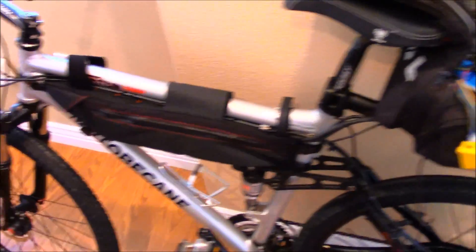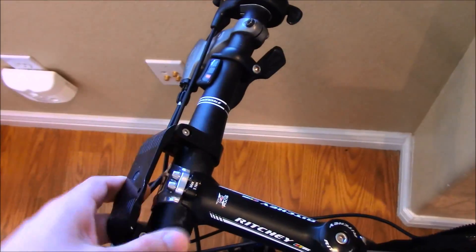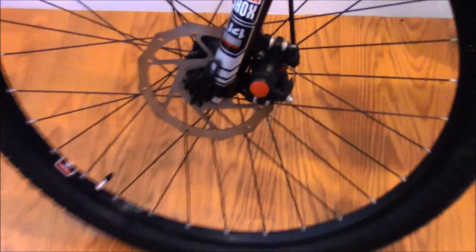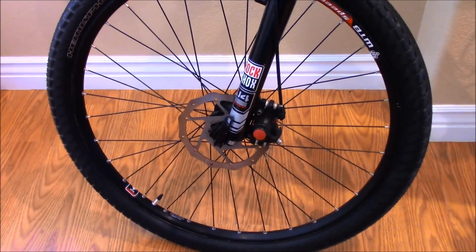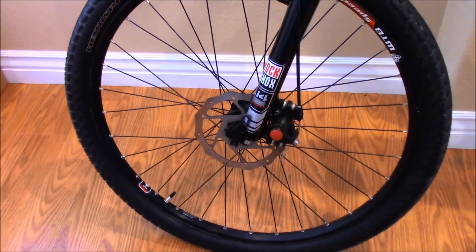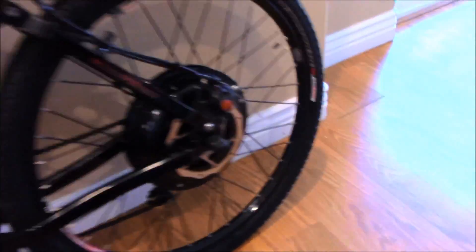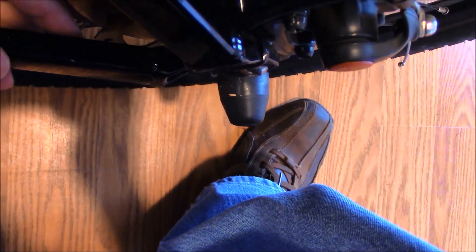The display is currently off the bike — I've got to remount everything since it just came back from China. The main updates I still need to do on this bike are the brakes. I need to go with hydraulic and bigger diameter rotors. Right now these are just 160mm front and back. At 72 volts you can go a lot faster, and you realize just how inadequate the braking is. I've got a 203mm rotor for the front and I'm going to go with 180mm in the back.